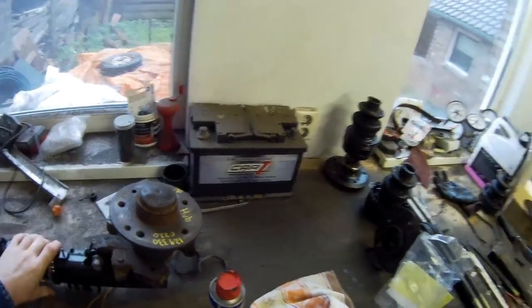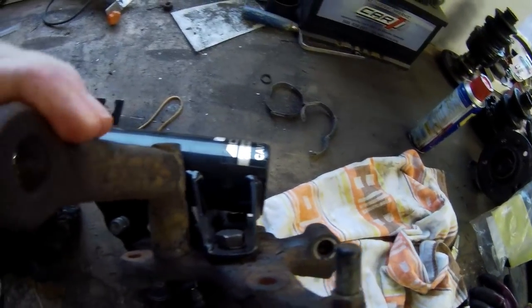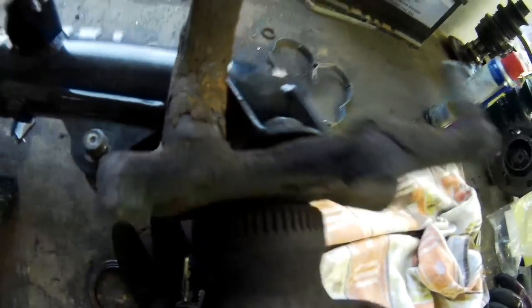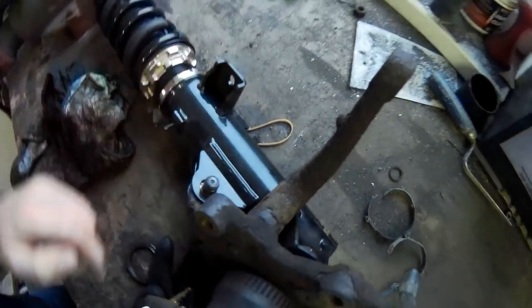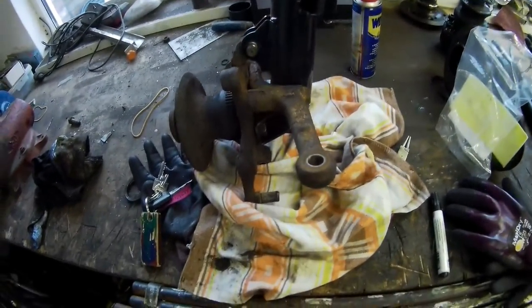Last time I mentioned there was a little bit of an angle difference in the wheel carrier. I cut about 2 millimeters out of it and welded it back together, and then it was a perfect fit — you can see it's just a perfect fit.